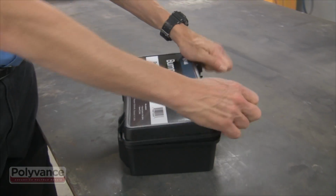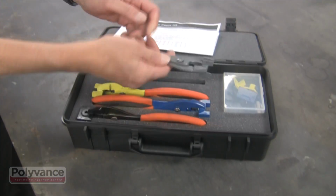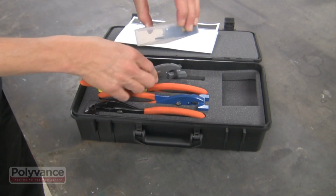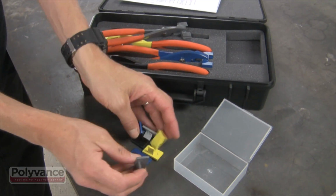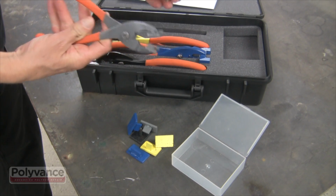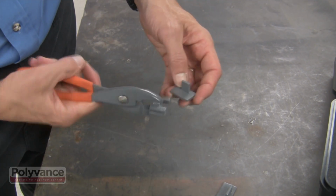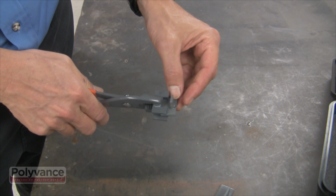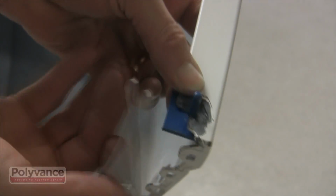The 6146 Bumper Pliers Kit is packaged in a convenient carrying case with a custom-designed foam divider to keep everything organized. The kit includes 4 customized pliers and 7 forming dies. The pliers and dies are color-coded for easy matching. There are 6 dies for different widths of rectangular slot tabs and 1 3/16" round hole to create the round recesses found on many bumpers.